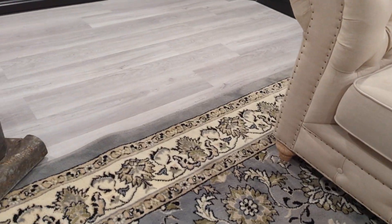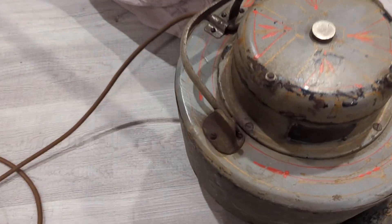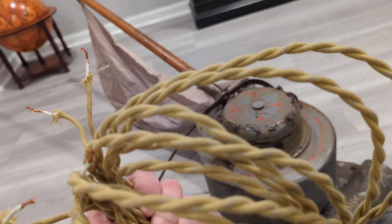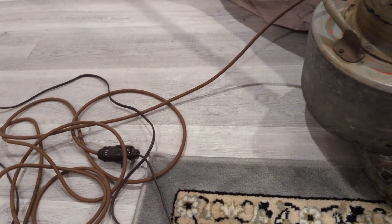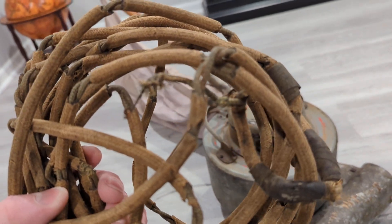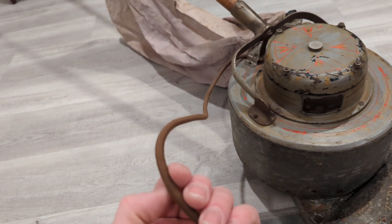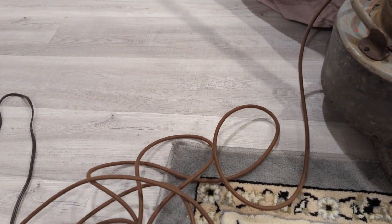When I received it, it had this power cord on it, which is a vintage modern reproduction twisted yellow cord. And if you've ever seen pictures of this particular machine before, it's had this cord on it. Kyle also is in possession of the original cord, which is obviously not something you would connect to power, so it needed to be replaced. I happen to have about a 20-foot length of reproduction brown cloth-covered cord that has the round profile instead of the twisted conductors, and that's a little bit more like the original cord.